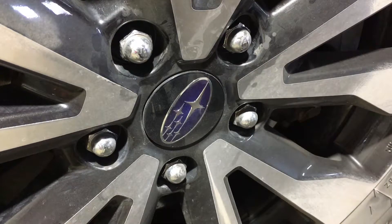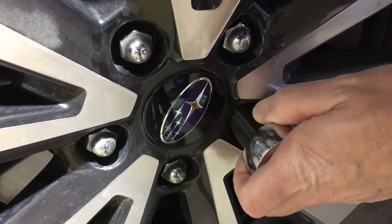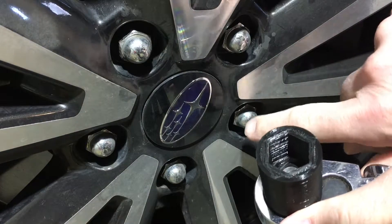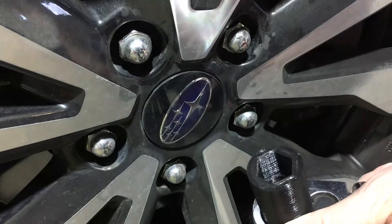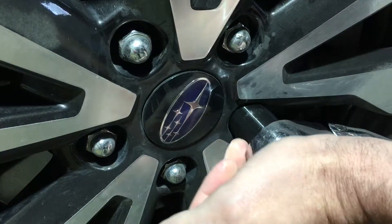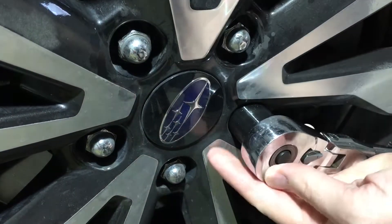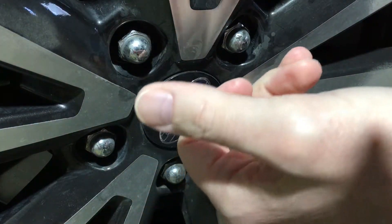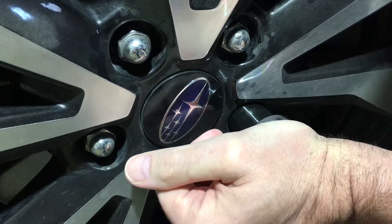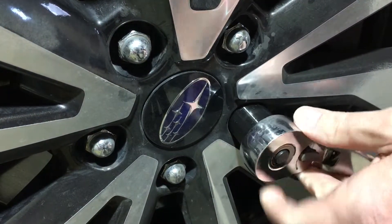We're at my wheel now. I think I torqued these to about 88 and a half pounds. This fits nicely on the ratchet still — I'll put it on here. This is quite a bit tighter now. That's another thing I didn't mention: I tightened up the tolerances so it would fit a little bit tighter. The randomization has made it kind of hard to put on — the previous one that broke slipped on a little bit easier — so I'll press this on.